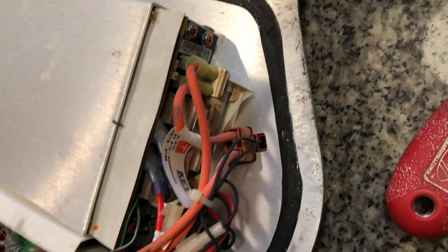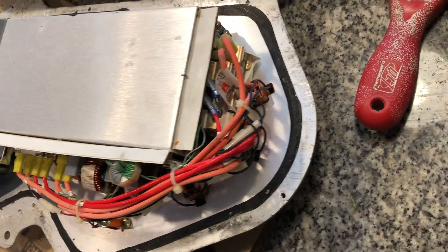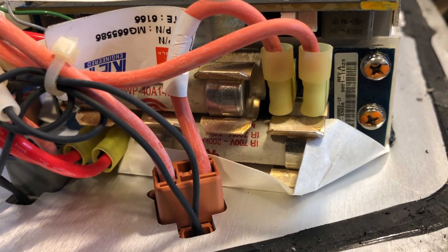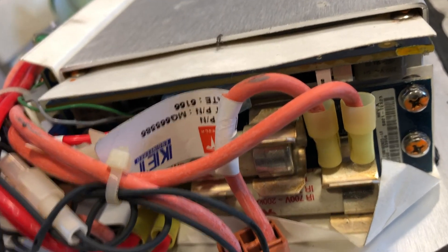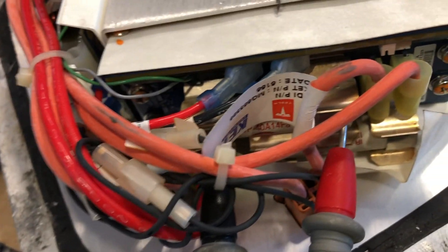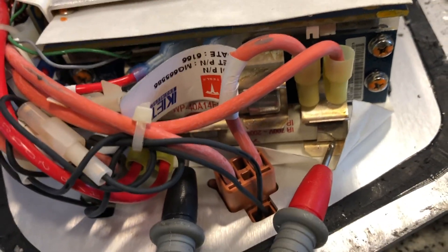Next up, I'm going to test the fuse, but I'm already positive it's dead. I'll fish it out and put the new one in. With my continuity tester, I want to make sure I replace the right fuse — I can tell which one's dead by putting the continuity tester on both ends of each fuse. I'm getting a good beep from the top fuse, but when I put it on both ends of the bottom fuse, nothing. That's my dead fuse.